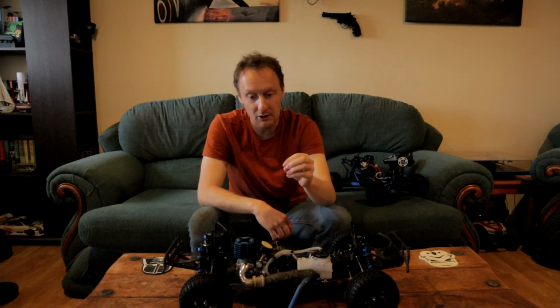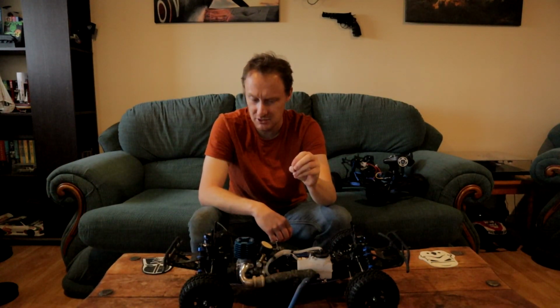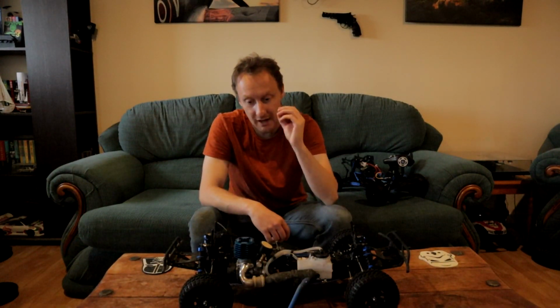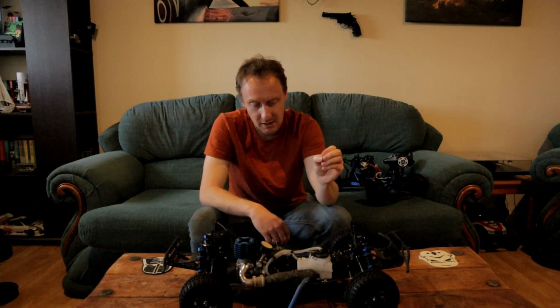When I was leaning it off to try and tune it in, I think I went too far. I was still having problems, it wasn't starting that great. I went richer again slightly on the high speed and the low speed actually. I think I went slightly too far with both, trying to get it to run right.